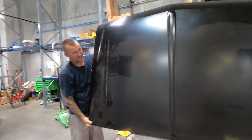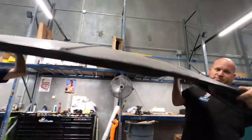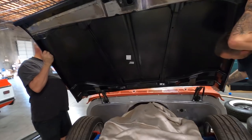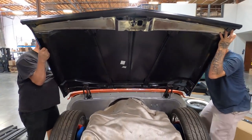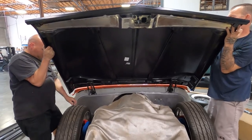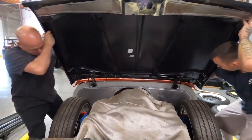The radiator's forward about three to four inches from stock. The motor's back another two inches, down three from where it was. The hood had to be modified just to clear — and this is one of the lower hoods, not like the '73 hood that's bigger and taller. The fun of this truck is going to be the fact that it has a completely stock-looking hood and fenders — you're not going to be expecting what you see when you open the hood.